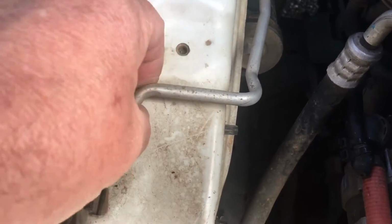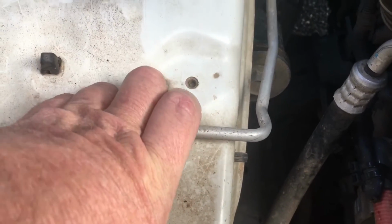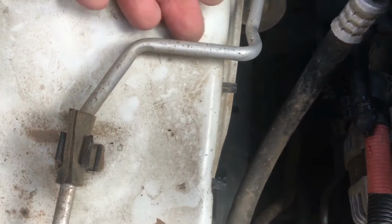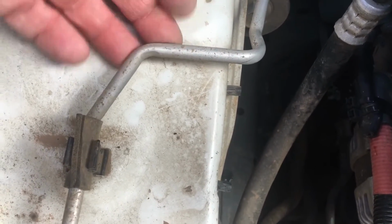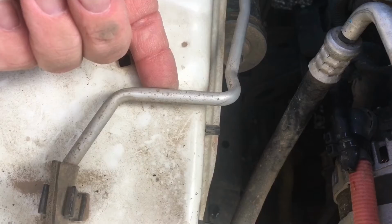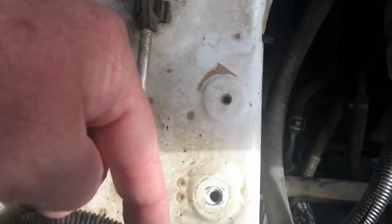So right now I'm just sort of going okay, and when I'm done I'm going to sort of just go. You can rework the pipes. It's what it's called, rework, not bending. Rework. Let's see, I've already made a little bit more space there. I want to have like a sort of 10mm gap, the same space as what the clamp's giving it here. Perhaps in a better design there'd be another clamp there as well, whatever, but don't bend these pipes.